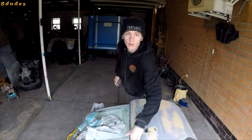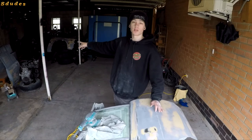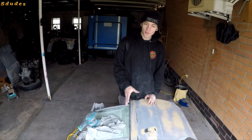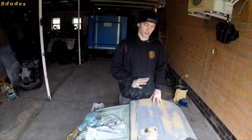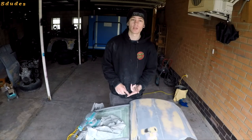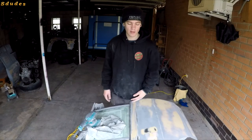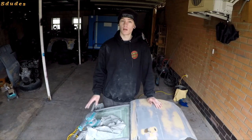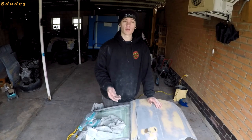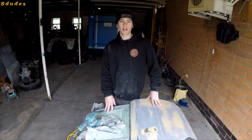I've got all the rest of the panels to go, and I'll repeat this process for each and every one of them. The goal is to get each panel straight — remove any high or low spots and imperfections as best you can, otherwise you'll be going through a lot more primer. For low spots, skim some bog and sand smooth. For high spots, hammer them out if you can to reduce bog usage. Thanks for watching, hope it helped, and stay tuned for the next one.